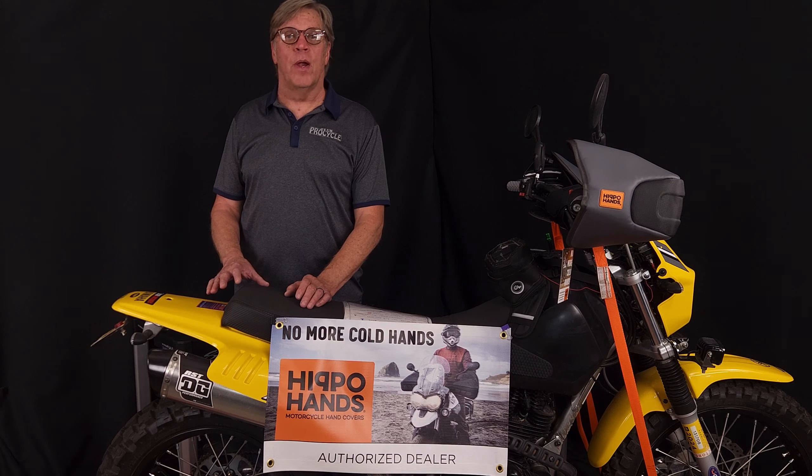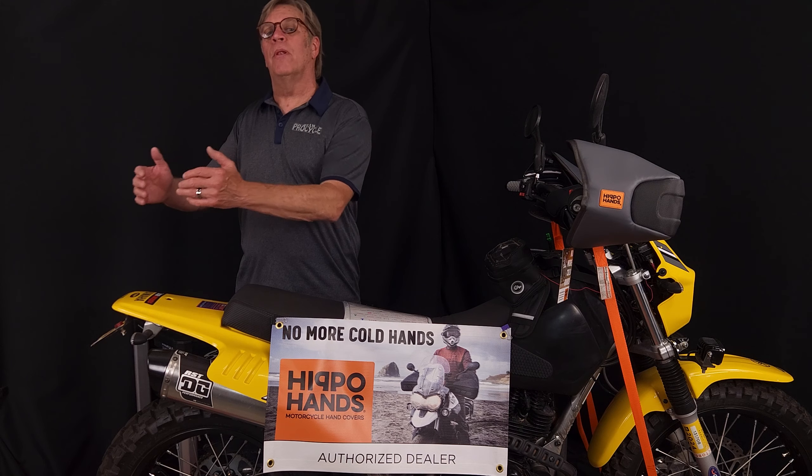Another great benefit of the TM40 flat slide carburetors: if you've been on your KLR or Suzuki and grabbed a little too much throttle at the wrong RPM and got a clunk-a-clunk response, or felt an oscillation when trying to hold steady throttle — the flat slide carbs get rid of all that instantly. You roll the throttle on at low RPMs, it doesn't matter what gear you're in, it starts to deliver now. Whatever you roll on, it's so much more controllable than vacuum-operated carbs.